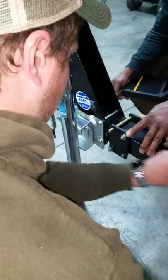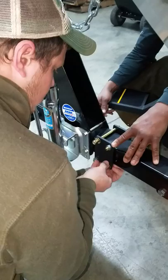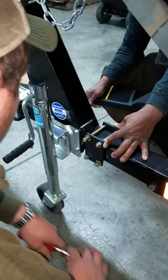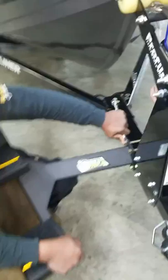Put those on, especially if you're by yourself — it'll hold the step enough that you can get the lock nuts started. Get two lock nuts started, and once you've got those on, you'll take the silver nuts off. You can do whatever you want with them. You'll replace them with lock nuts and you should be good to go. The silver nuts are just there to help you so you're not fighting a lock nut when you're first trying to put it on, especially if you're by yourself.